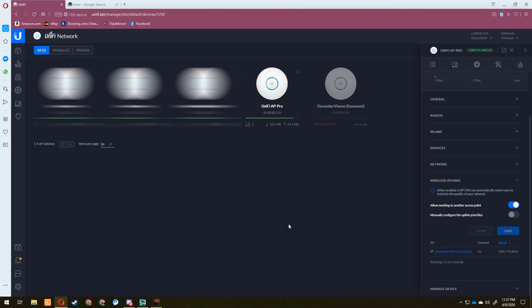That is how you establish a wireless uplink on Unifi devices. As I said, it's a last-ditch effort if you have no other option. You don't want to wirelessly uplink all your APs indefinitely — performance would be pretty poor. But for something temporary or that doesn't need high performance, it's not a bad option. You want roughly 80% signal between your two access points for it to be worthwhile. Your mileage may vary — all houses are different and walls block signal differently. Happy networking!